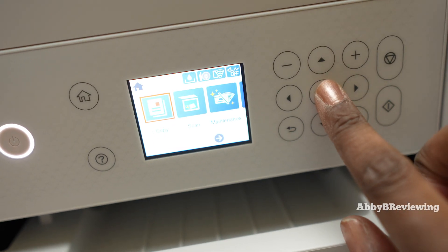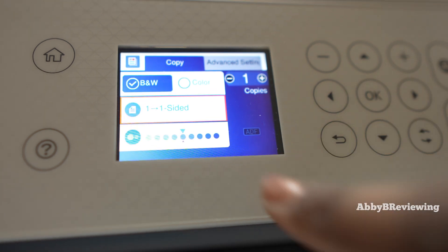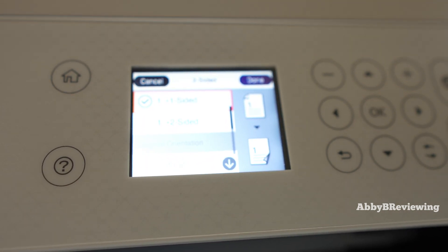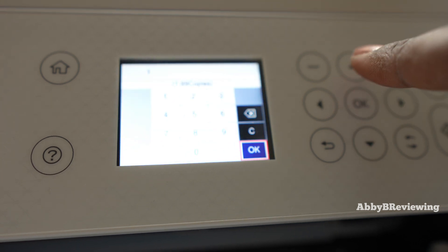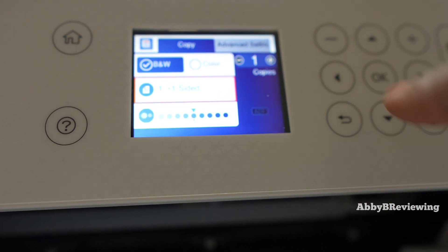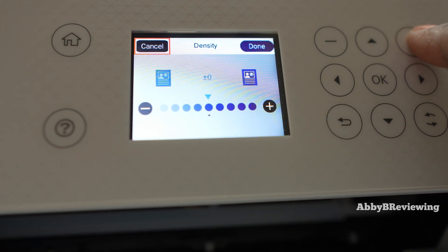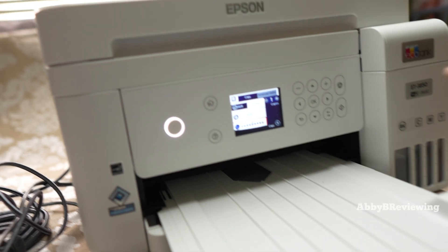Come down to the touchpad and press OK to select Copy. Now you're going to use the touchpad to select your options — keep in mind this is not a touchscreen. You can choose black and white or color; I'm doing black and white. You can choose one-sided or double-sided; I'll do one-sided first. Use the arrows to choose how many copies — from 1 to 99; I'll do one. The last setting is darkness: leave it at zero to copy as-is, or use plus and minus to go lighter or darker. Once done, pull out the paper tray and click the copy button.